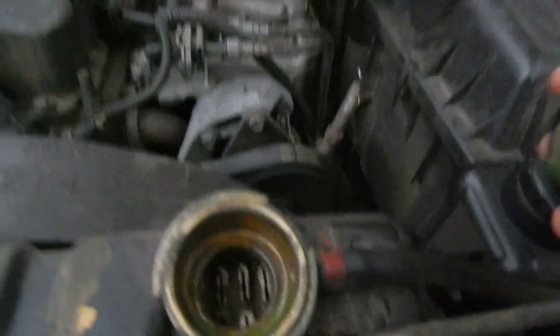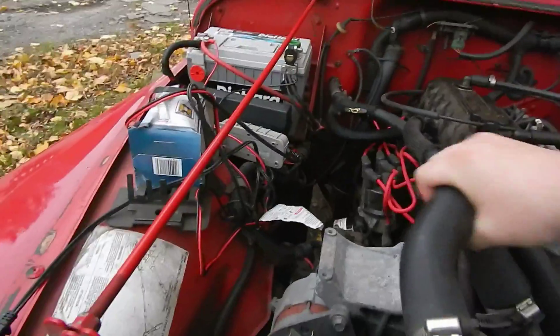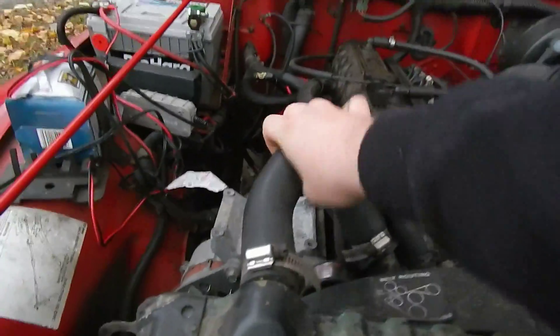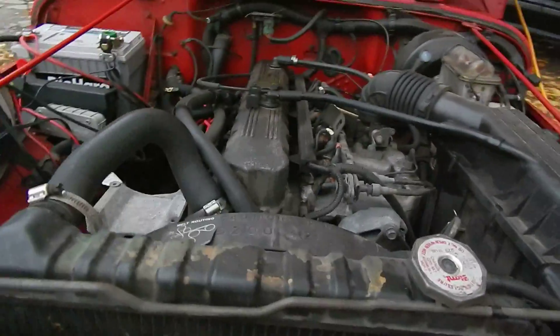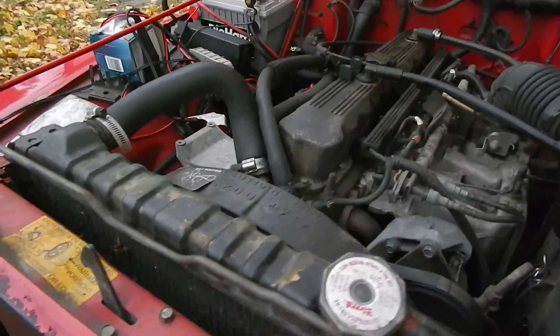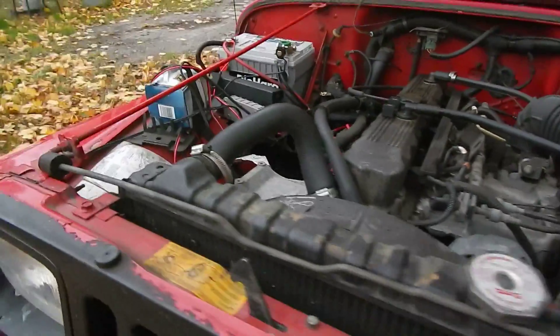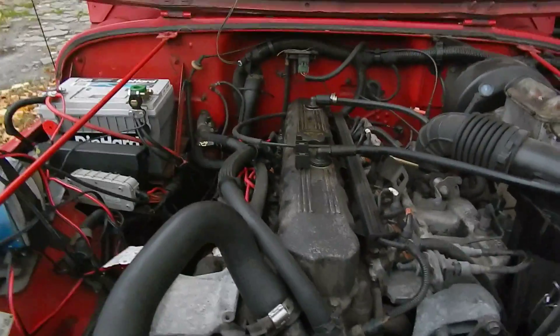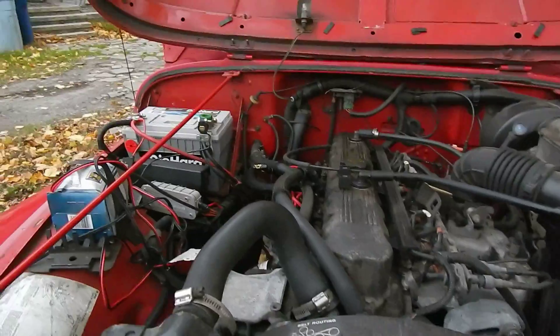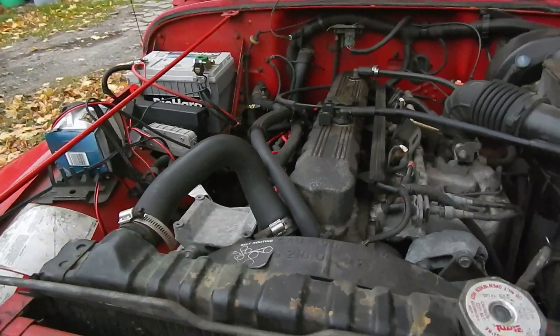So if I open up the radiator, there is coolant, but it's lower than this hose, and this hose doesn't really even have any coolant in it. It's a slow leak, not too terribly big of a deal, but it's something that does need to be addressed in the next couple months. Plus it's getting cold, so as my coolant drains a little bit more, I lose heat. So I'm going to replace this and show you guys how to.